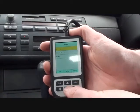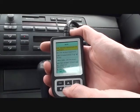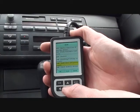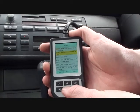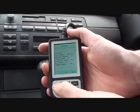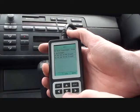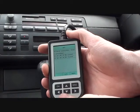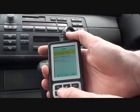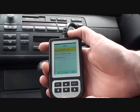While we're here, we also have the airbag light showing. I do actually know what the problem is with the airbag light, but I'll just show you since we've got this tool here. SRS airbag — and again, just a bit of information, then read the trouble codes. So it's telling us that the belt tensioner, front passenger, there's a problem with that. I do know about that — it's just a connection under the front passenger seat, which, once we connect that back up and erase the trouble code, the airbag light will be extinguished.